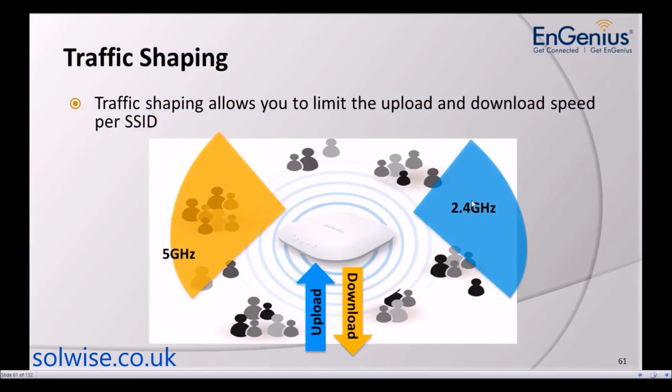Traffic shaping. Now, this is basically QoS per SSID. Remember, literally two slides ago, we talked about bandwidth shaping per port, per access point. This is traffic shaping per SSID. So this is bandwidth control per SSID. So this is how we can actually put limits on the upload and download speed per SSID, be it on the 5 gig and or 2.4.